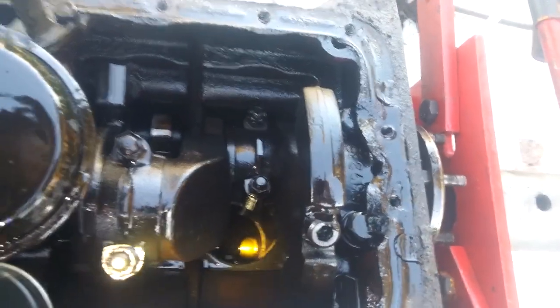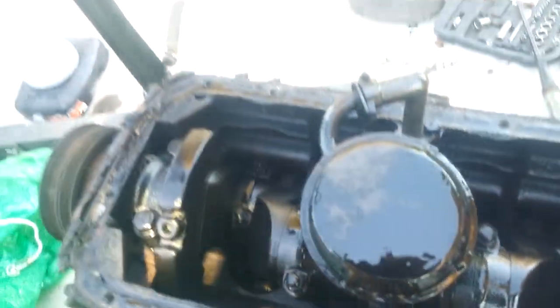I still don't know why I'm only getting 60 psi of compression. I'll have to adjust all the valves and I might hone the cylinders and put new rings in it — but I think that's probably all I'll do. This was good news. The inside of my engine looked good: the camshaft lobes weren't worn down, there weren't huge chunks of metal in my oil pan, the cylinder walls weren't scored. Maybe this engine will get my Willys all the way to Moab.